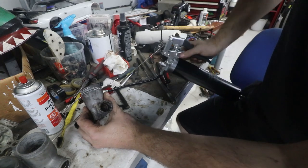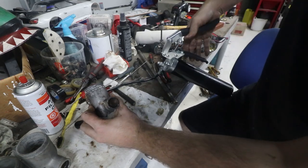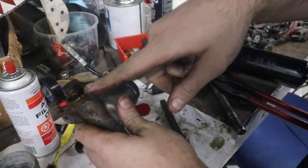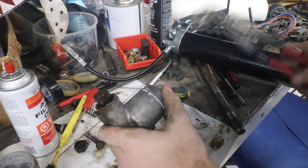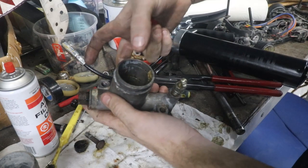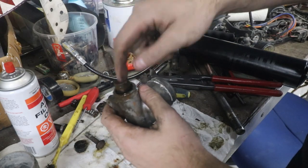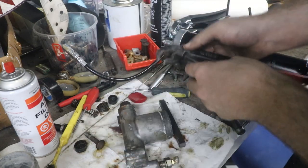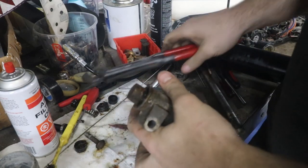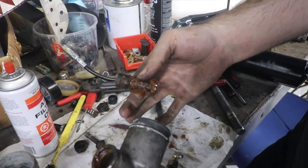If you can see down inside there — so once we've got it as far out as it'll go until the grease starts popping out the top, there's two options. Either drop a piece of rubber down inside, put a G-clamp on it to cover the hole and keep pumping it out — that's for ones that have a long snout in them. This one's short enough that I can just grab it and hopefully work it loose. A bit of wrestling in the vise and there's the piston.